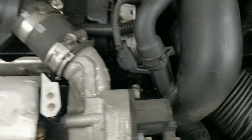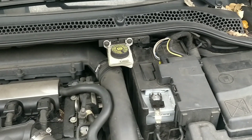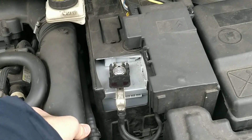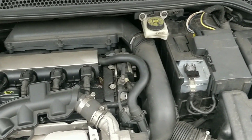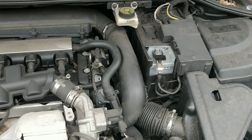Then I was rooting around and I saw this — which is a huge split. The whole pipe split. And that goes into the turbo, so that's the issue there. It's a pressurised pipe, Paul told me that this morning. So that means it holds a lot of pressure in there. The fix needs to be temporary — I have ordered the new part, but my dad needs to use the car generally because of his mobility. So I do need to just do a quick fix today. Glue, tape, whatever it takes just to get him back on the road for a few days.